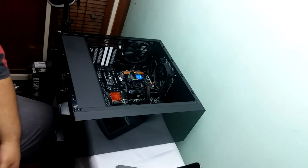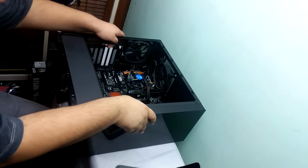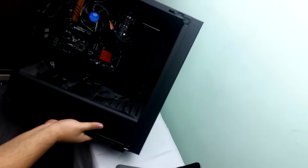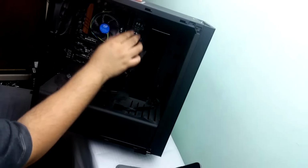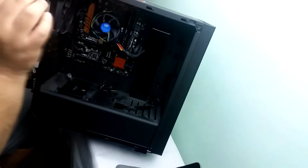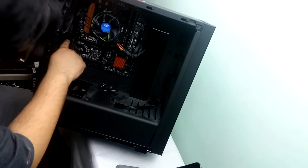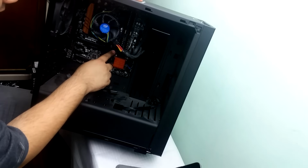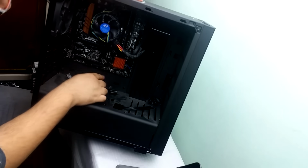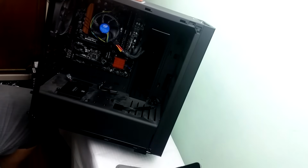So, as I was saying, if I were going to be using this motherboard permanently, I would probably realign the motherboard standoffs. Like I was saying, we have a standoff over here, over here, over here. That basically means I have a screw point there, and that's a good base, a good little leg for the motherboard. And we have a standoff here, here, and here. This is the convenient little peg standoff that we don't need to screw, just so we can lock the motherboard in place. And we have a missing standoff here and over here, on the bottom of the case, because it's designed for bigger motherboards.